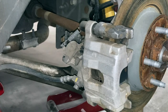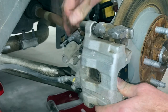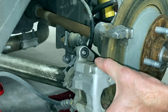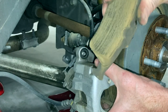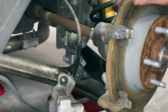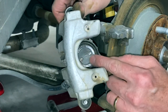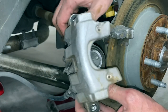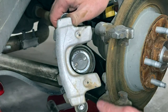That's not hard — it should come off. So there are my brake shoes, which still have tons of wear on them, and there's the other one. Take it off so it doesn't fall off. Now here is the thing that we're looking for right here — the piston. According to what I've seen, we need to turn this clockwise as far as it will go, and that will reset it.